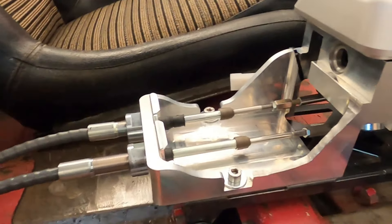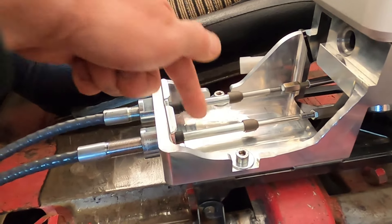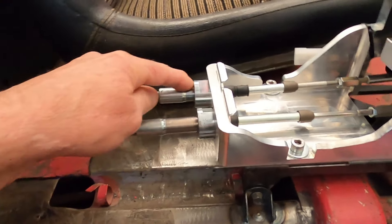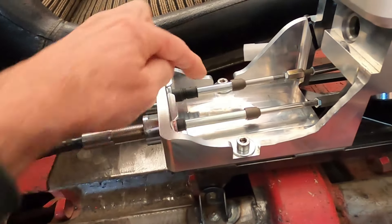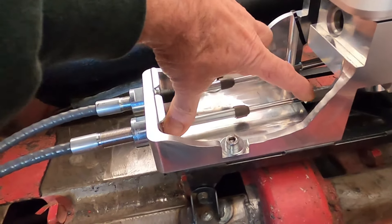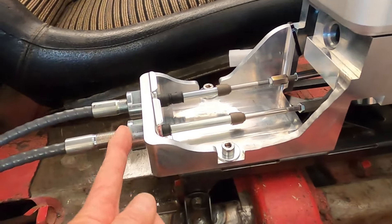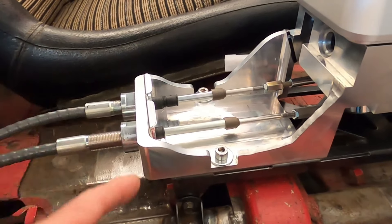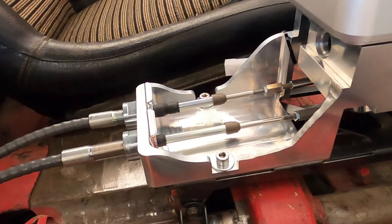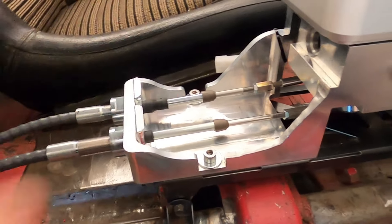Here's what's going on, and these are my lesson-learned takeaways from this custom cable speccing. What I didn't quite understand was that the physical components — this is a little deceiving because this one's threaded much farther back in its collar — but this component length is an inch longer than this one. Since this inner rod travels an inch farther, this whole assembly is a completely different dimension. The Ferrari cables were 4-inch travel; I specced it based on measurements, but the long story short is: once I understood that this was a changing dimension regardless of what length you specced the housing, it was a simple matter of saying I need a three-inch on one end and a two-inch on the shifter end.